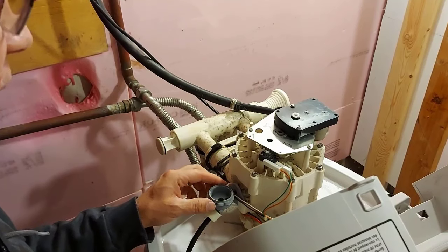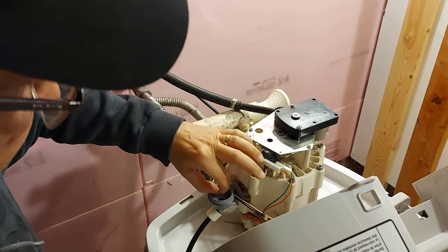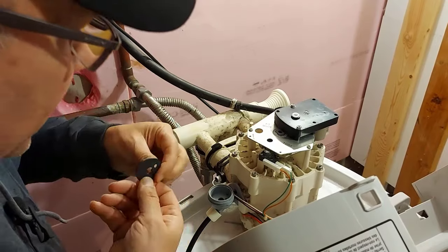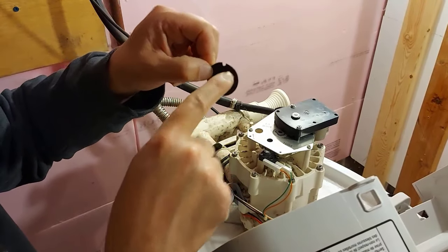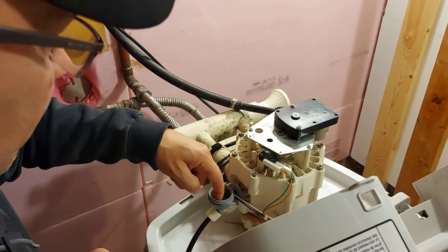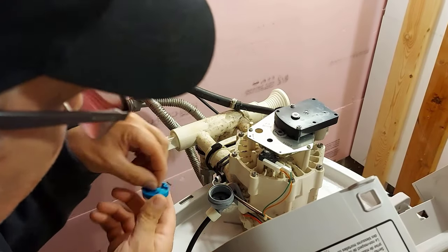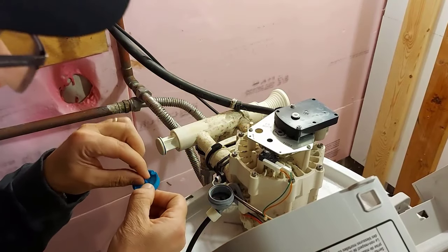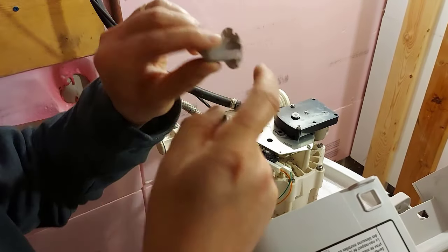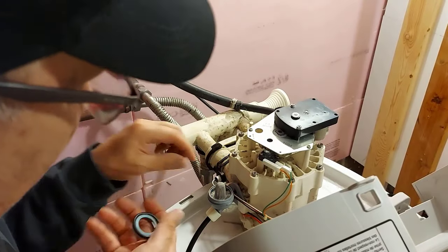Here we are at the venturi. We're going to put the gasket in, but first we have to put this tiny little cone filter into the hole that's there. Then we're going to put this gasket in — you want to make sure that hole goes over top of that screen, and there's a number on this gasket, make sure it's facing up. Now we're going to put this part in, which has a rubber washer — make sure it's in there. Then we put our cone in; see, all these have a groove and a keyway.